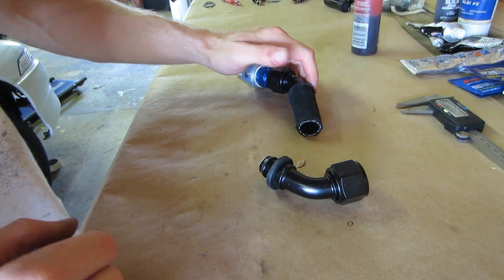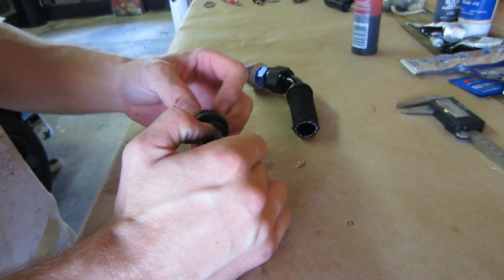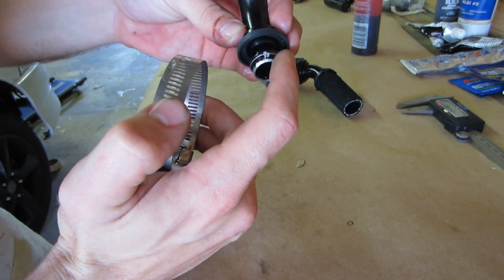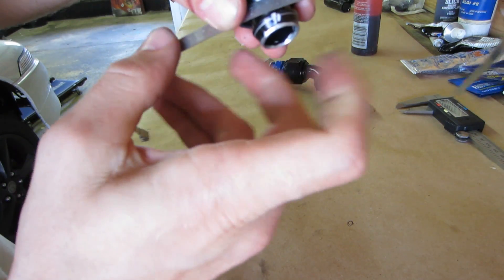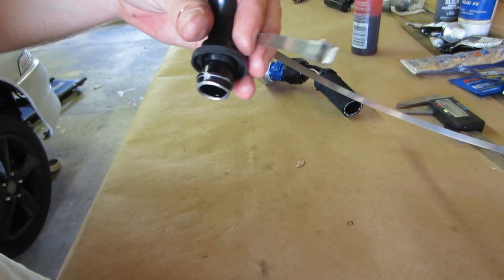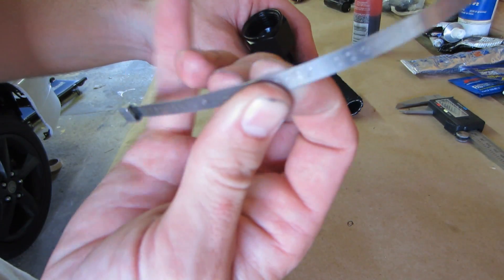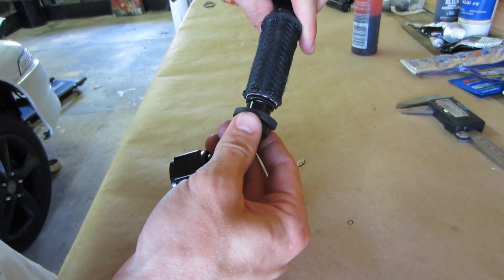At this point you have a few options. You can use regular hose clamps to hold the hose on as an extra precaution — keep in mind you did cut two barbs off, and they designed it for three barbs, so you definitely want something extra to hold the hose on. All the hose clamps I found are about twice as thick as they need to be and won't even go behind the barb. So I decided to use some leftover boot band clamps from doing CV boots on this car — there's plenty of room with those. They do take special pliers. They also sell dedicated clamps made for this purpose, but I'll be using these metal bands to hold my hose on. If you're using hose clamps, put them on now before you assemble the next part.